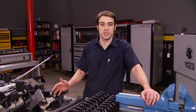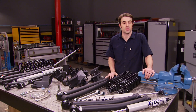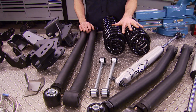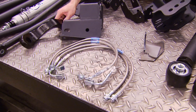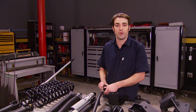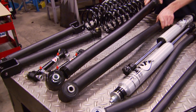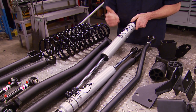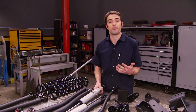We plan on using our newly converted four-wheel drive Wrangler on some pretty hardcore trails, so we wanted to go with a suspension kit that was up to the task. We ended up going with this BDS four-and-a-half-inch long arm kit, meaning these long arms will replace the much shorter factory control arms. The kit is comprehensive: it includes coil springs and shocks for all four corners, heavy-duty upper and lower control arms for the front and back, sway bar end links, all the bracketry and hardware, along with a drop pitman arm and extended brake lines. We've also got the optional adjustable front and rear track bars, optional JKS Ultimate Sway Bar Disconnects, and an upgrade to Fox 2.0 Performance Series shocks custom-tuned and valved specifically for this lift kit and our Wrangler.